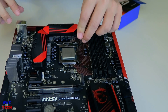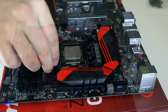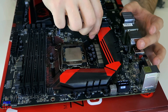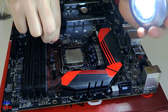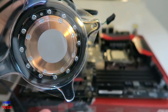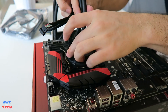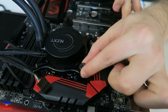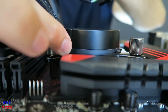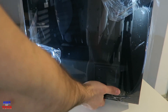Lower the lid so the opening goes underneath the screw, then slide the retention arm forward and under the locking mechanism. For the rest of the X61 Kraken cooler, install the provided standoffs by hand. The X61 has pre-applied thermal compound. Install the pump's pre-installed bracket with standoffs through the inner holes, then tighten the thumb screws in a crisscross pattern for even pressure on the CPU.